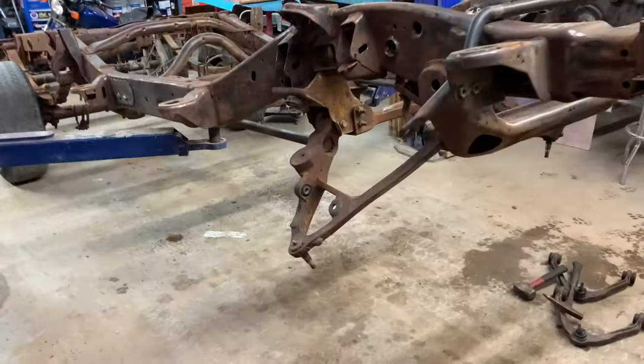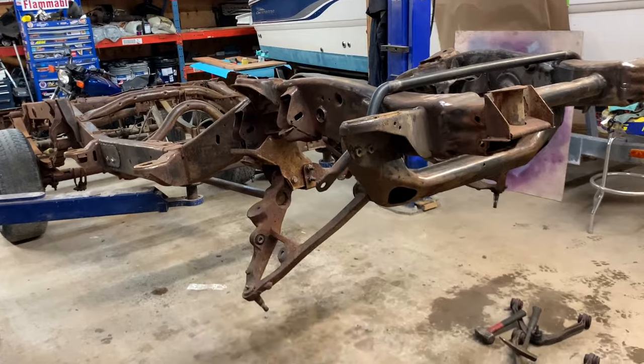That's perfect. When you're installing control arms, when you go to tighten the bolts up, you should tighten them up with the weight of the vehicle down on the suspension so that the control arms are in their normal placement. Because if they're suspended all the way down, you tighten the bolts up, and then in order to get to its normal ride height, the control arm needs to move and flex, and then you risk tearing the bushing away from the sleeve. Which of course causes the bushing to wear out faster and all that fun.